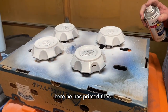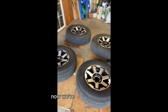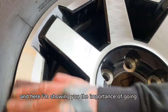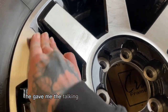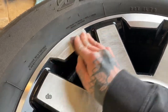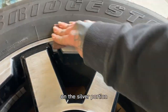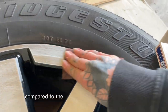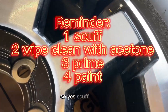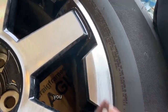Here he has primed these. We've removed the wheels off the 4Runner and now we're prepping the rims — the wheels, the rimmy wheels. Here I'm showing you the importance of going with the grain this time. He gave me a talking-to when we got to the rims, and I realized I never knew that. The rims especially have a little bit of corrugation on this specific style rim on the silver portion, which was a little different compared to the old 4Runners — I had a lot of third gens prior to this. Scuff it all up and make sure you get in those itty-bitty corners.